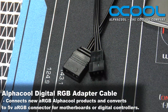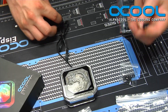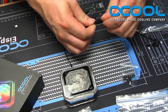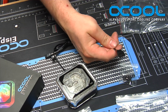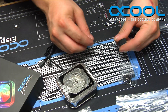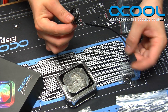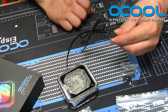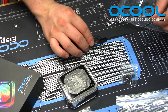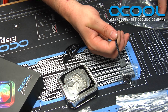Most importantly, there is a five-volt digital RGB adapter cable that allows you to connect the proprietary end into any five-volt addressable controllers or the five-volt addressable port on your motherboard. I took that adapter cable — included in the hardware kit — and plugged it into the AlphaCool block; then all you do is plug it into a controller or your motherboard.